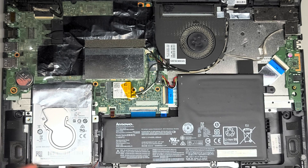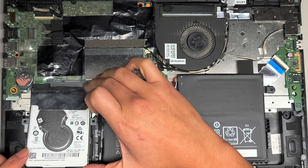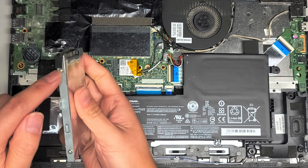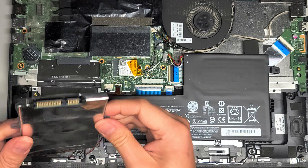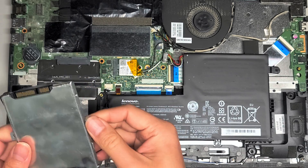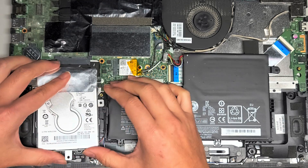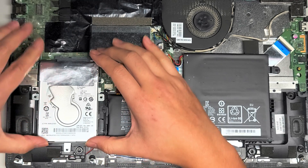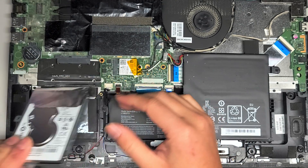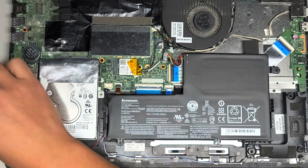Once you pull the three screws out it should come out. There we go — it was kind of stuck. Once you slide it back like that, you can take it out. This is a two-and-a-half-inch SATA hard drive; you can upgrade this to an SSD. There are four screws on the sides holding it in place. This metal bracket is separate from the foil — you don't need to transfer the foil to an SSD. Just take the metal bracket out with those four screws, put it on the new one, drop it back in, and slide it back in place. The reason it was stuck is there are foam pads under here, and after they sit for a long time they actually get stuck in place onto the foil.